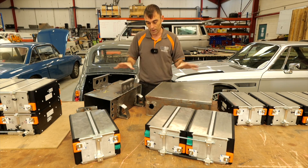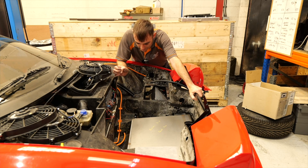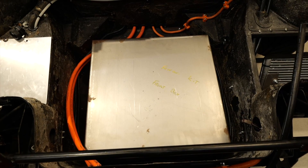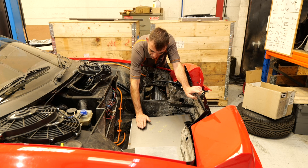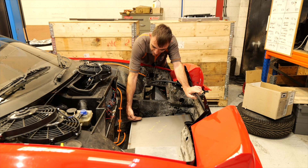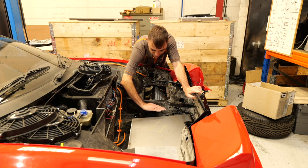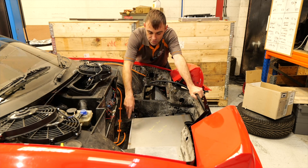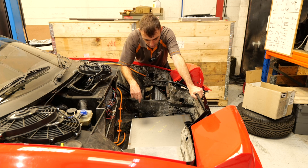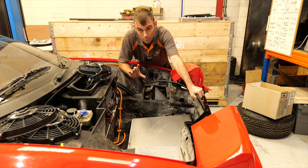Now you've seen what we've done and what the plan is for these battery packs, it's time to see where they go in the car. There's the front battery box in, and there's the fruit of our labour — or my complexity. I definitely made the right decision because the original battery box was around about that height, and now it's down here, exactly the same level as the original boot floor, because essentially there was a spare wheel in there — that's now gone, and the battery box is in its place at exactly the right height. The original carpet set will even fit directly in there. We've just got to finish off the cabling — high voltage is already coming in, just some ends to make off and coolant lines to cut. Then it'll be time for this and the rest of the battery pack and motor mounts to go off and get blasted and powder coated.